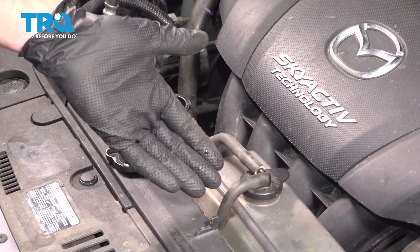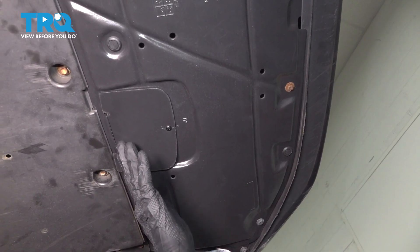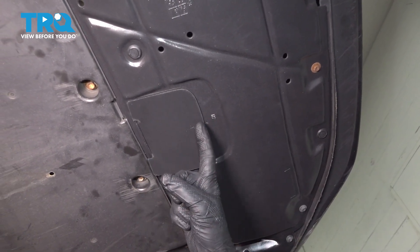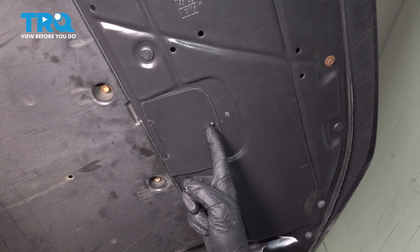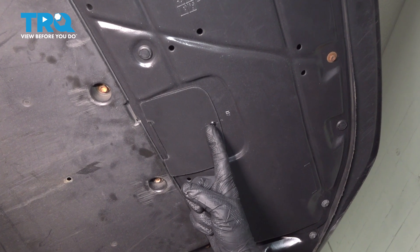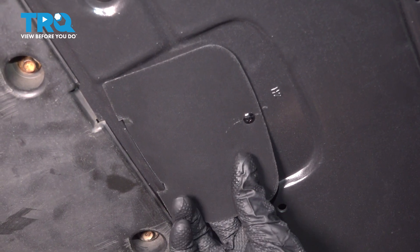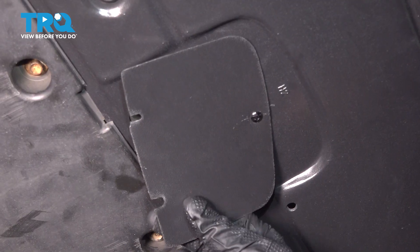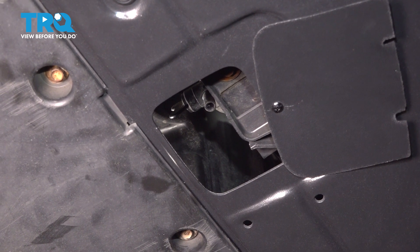We're going to have to make our way safely under the front of the vehicle. Now we're going underneath the driver's side front of the vehicle. On the front splash shield, you should find that you have an access panel. They do have a mounting screw, but you don't actually have to remove it — you can just use that as a pivot point. I'm going to gently start pulling this down along the rear; it has a locating tab. I can pivot this and, looking up inside this area, we can see our drain plug.